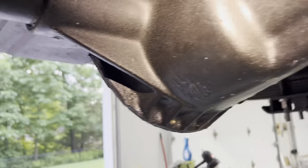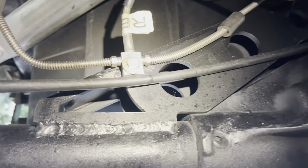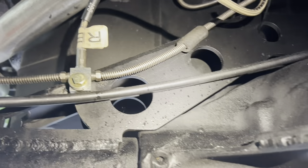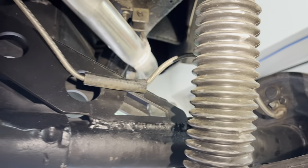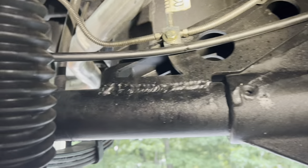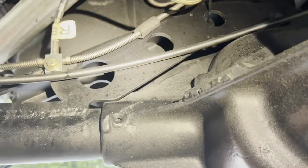Here's what the rear side of the truss looks like. I made a hole here — it wasn't there for my brake distribution block, but I drilled and tapped a hole to mount that. You can see the other side of the truss — it fit nicely on there. Using stock brake lines and nothing fancy. Like I said, about a $200 part, and it brings quite a bit of strength to this Model 20.